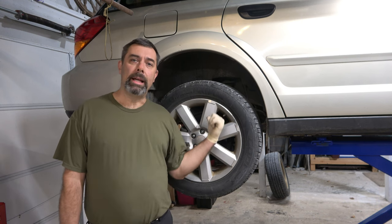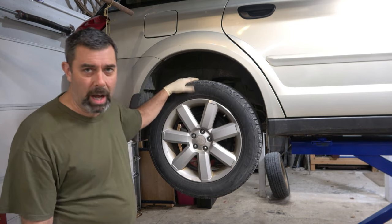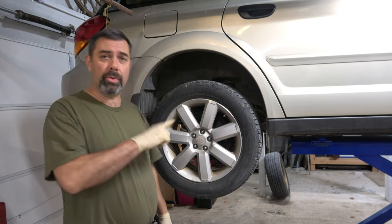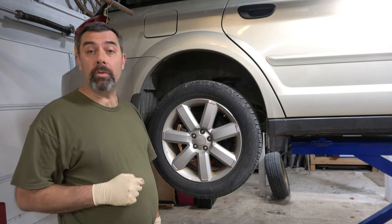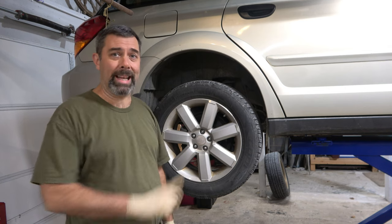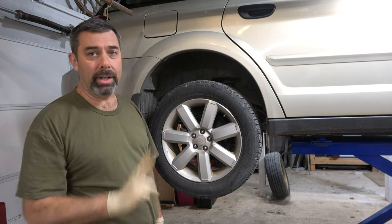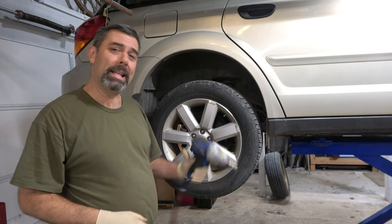Sorry about the rain, but it is time to move on to the back — and this is where the bread and butter is at. I'll try to get this filmed as best as possible. First thing we're going to do is remove both the rear tires. Then we're going to remove the upper strut bolts first, then the lower strut bolts. That'll give us the opportunity to get the struts out without a second hand. The bolts for the top of the strut are actually inside the car, so when putting it back together you're going to need a second set of hands.